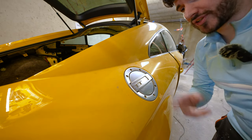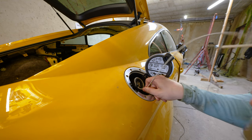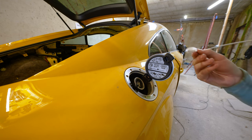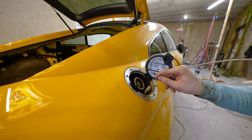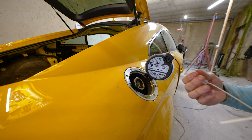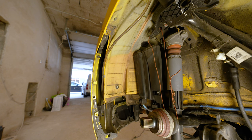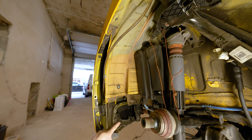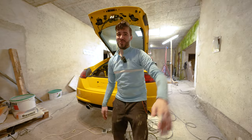While we are in here cleaning the drains, you're probably wondering what I'm doing here. There is actually a drain on the bottom of the fuel filler cap area, and it also gets super dirty and blocked. You should probably clean that as well — use the same or a slightly thinner brush and gently go all the way through. This is the drain hose that goes from the fuel filler cap all the way down.